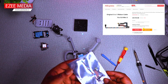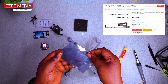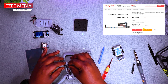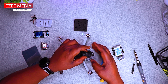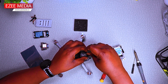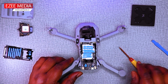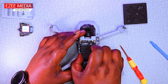Don't forget to put the gimbal flex cable before you cover the bottom plate. Here you have the flex cable — again the link is in the description below just like you see on the screen. At this time I ordered the gimbal rubber which hasn't come, so I'm just going to put back the old rubber for now. When the rubber comes I'm going to continue. Be careful not to wipe out the blue grease at the back of the plate.